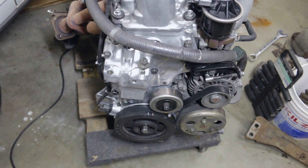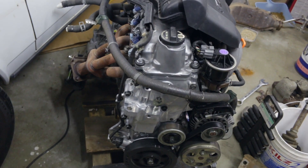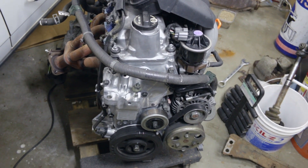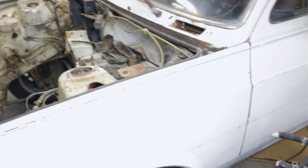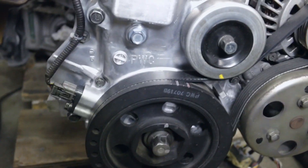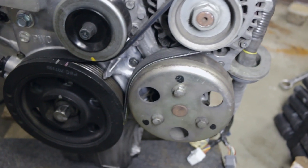I need to essentially make a jig of the points on the Honda Fit engine bay that connect the engine mounts together, then take that jig — like a pipe with some plates with bolt holes — and bring it in there to see where best to put everything. Then this guy can go in. Look how clean that is — the new plate — and I deleted the air conditioning compressor on the front and put in a shorter serpentine belt, super simple. Everything looks really good on this engine, and it started right up even in its compromised state in the crashed vehicle.